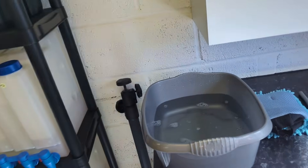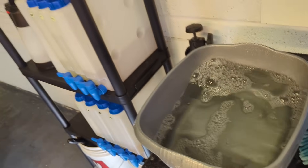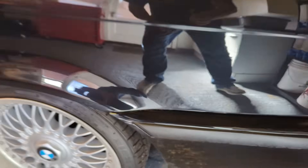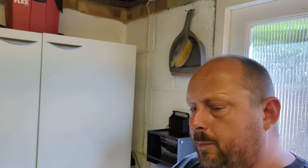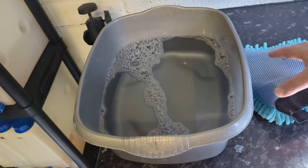Use a detail brush just to make sure it's all mixed up and evenly distributed. Now, you're probably looking at this car thinking it's pretty clean — if I zoom in, it's got a little bit of road film from driving and some dirt underneath. How dirty will I wash a car with waterless wash? Typically just to get dust and low dirt off the car. The limitations are wherever you don't make contact, because you're not using a pressure washer, you don't clean. If you don't get in those crevices, if you don't go underneath that spoiler or in there with a brush, it doesn't get clean — you get no free cleaning like you do with a pressure washer.